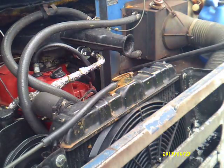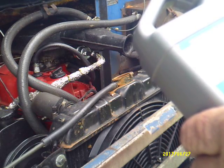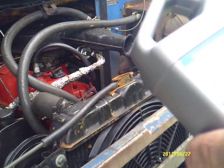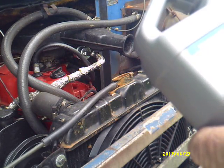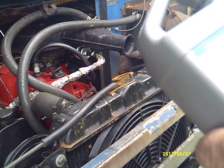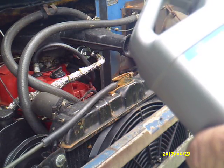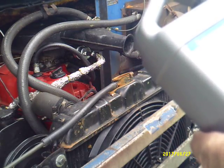And the directions are: drain, cool it, add 1/4 ThermoCure, and fill with water. Drive the vehicle for 3 to 4 hours, up to several days, for extensive rust. You may drive the car normally during this period. Drain the cooling system and flush twice with water. Refill with high quality coolant mixed to manufacturer specifications with water. Do not use in freezing temperatures.